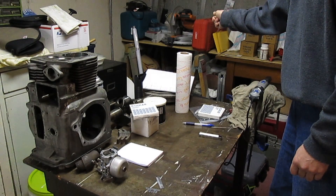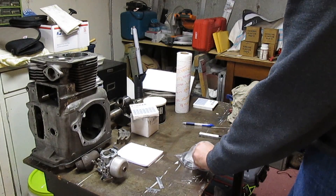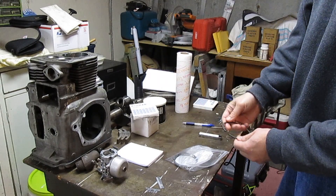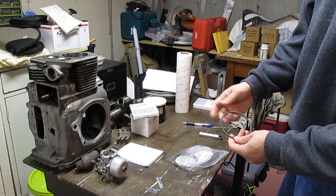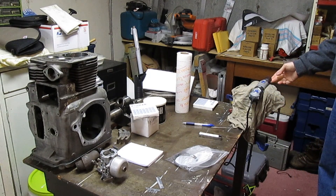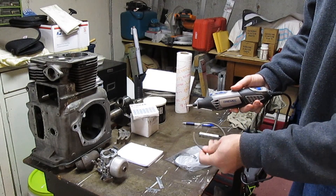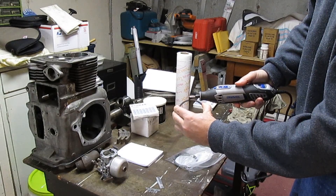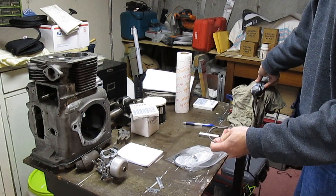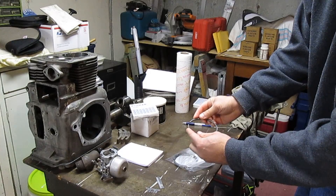So how do I do it? It's pretty simple. I'll use this ring set for example purposes. Initially, with a 30-over ring set it shouldn't fit in a 20-over bore — that's correct, I couldn't get the 30-over ring set into the bore. So that means I had to end gap it. Basically I take the ring like this, just touch it together, and I use my Dremel. On my Dremel there is a small stone wheel, and I just lightly touch the ring to the wheel like that to grind the ends down — very slowly, very lightly, being very cautious to keep the ring nice and straight, perpendicular to the stone, so that we get a nice straight edge.